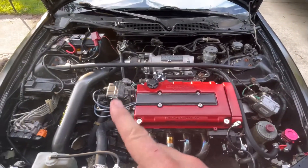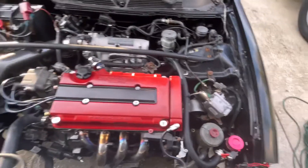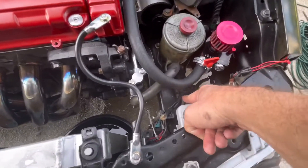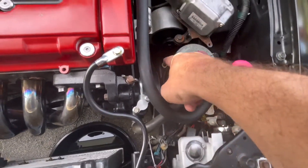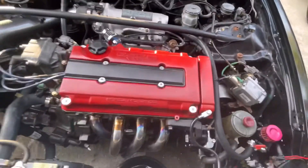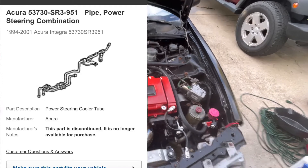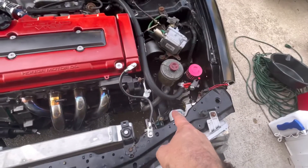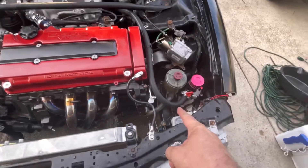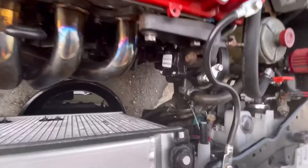We're going to redo the wiring and pull some stuff off, and when it's not being driven we can do all the work properly. We'll have to replace the line that goes from here, back underneath the cruise control, and down to the rack. That part is discontinued — I'll show you a picture — so we're going to have to fabricate a new line: get some line and actually bend it, flare it, and do all that. But that will be in a much later video.